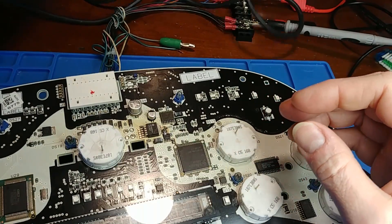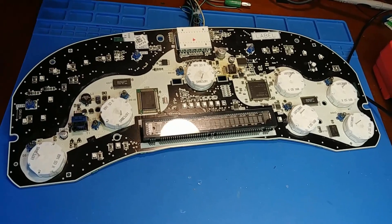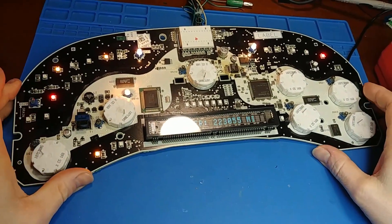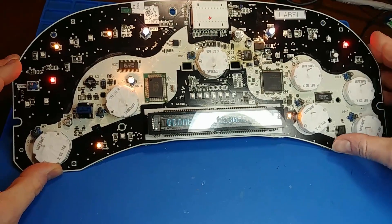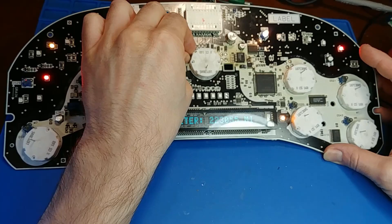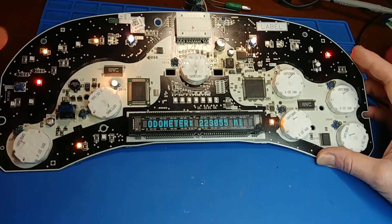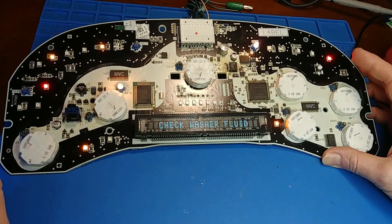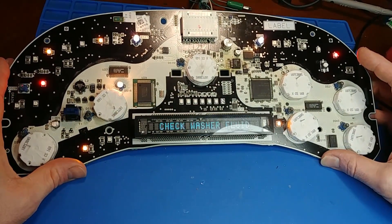Inductor is back on. This is the moment we'll find out if it'll work or not. Hit the power button — that's a good sound. Yeah, the display's back up. It's fixed! It does have a bunch of burned out bulbs — the trans-temp and RPM areas, and there's definitely no light for the miles per hour. There's really only one working bulb if you don't count the blinkers. This still has the original old stepper motors in it, so at this point I'm just going to do the full rebuild on it and I think we're going to be okay.